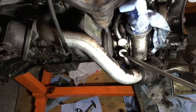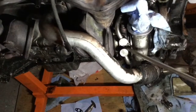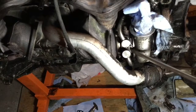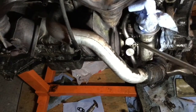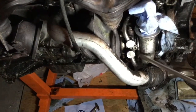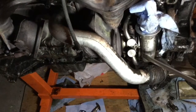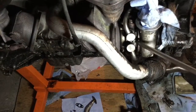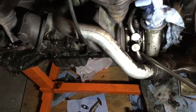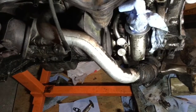So I have to remove those anyway. These two hoses — sorry — they hold with this single bolt here. It's like a flange that is welded to this head here, and both flanges overlap, and that bolt holds them in place in the turbos. So I'm going to remove that one, pop these two out, and then it's going to be very easy to reach that rear bolt — it's going to make my life easier in order not to strip that bolt.